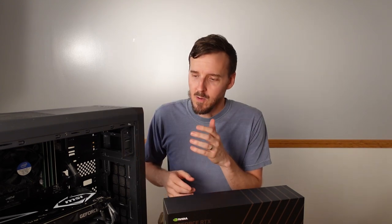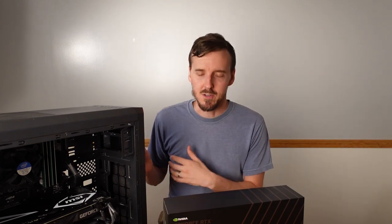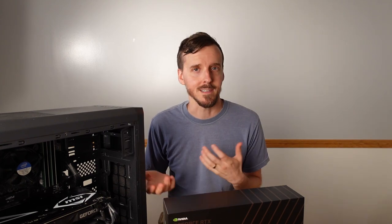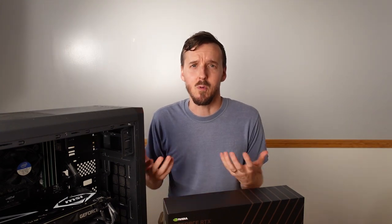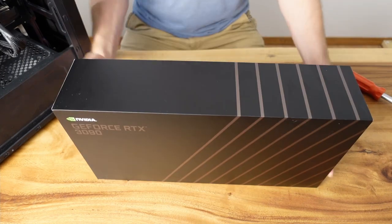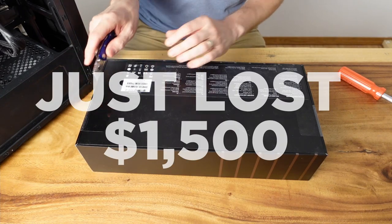I'm an artist and not exactly a computer tech — bear that in mind. What I did have to do was change the power supply: I had a 600 watt and the card says on the back it takes at least 750, so that had to be installed. Of course there's all sorts of routing cables and things like that — they're difficult. The other thing I had to think about was the width of this thing, which is three slots wide. I might have to build some sort of support structure, maybe out of Legos or something. All right, here we go — I don't really know what to expect.